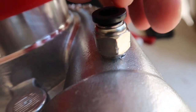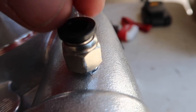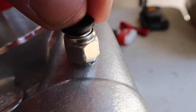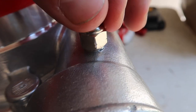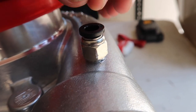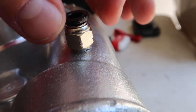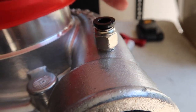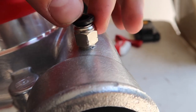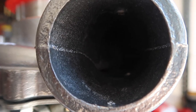The quick disconnect has teeth on the inside that hold the vacuum line in place, but they don't fully bite into the line to where it'll rip or strip anything. So if you simply have to take the turbo off or this piece off — the wastegate, the blowoff valve — because I'm running these connections on everything that needs a vacuum line for boost. It's easy and the lines themselves are really good. I saw some guy building his turbo Silverado doing that, took it as a good tip and I'm doing it for myself too.